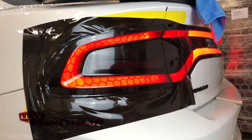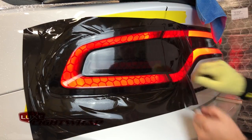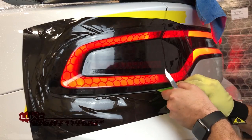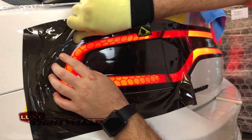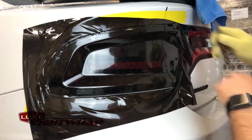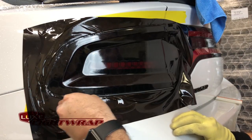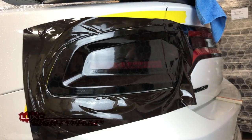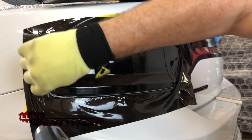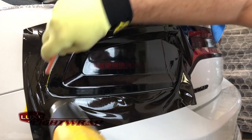Grab the key while we let it cool so you can see the honeycomb effect. Let's take our knife and trim right around the edge of the light, trimming on the bumper side. Use the squeegee to lock the tint around. Running the blade along the fender part of the car but not perpendicular to it, so I'm not in jeopardy of scratching the paint. I first use my finger to help the vinyl get around that corner so I don't put a crease in it.